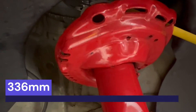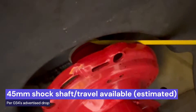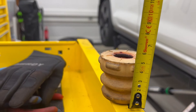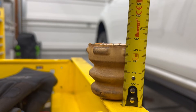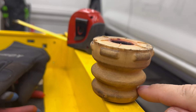We've got the hub height set back to 28 millimeters higher than stock ride height. With a tape measure shoved in here, we're looking at about 45 millimeters worth of available shock shaft, which we can use to figure out where to trim the bump stops. The stock unmodified bump stop is sitting at about 54 to 55 millimeters total, and we have 45 millimeters of shock shaft available at what we hope will be ride height.